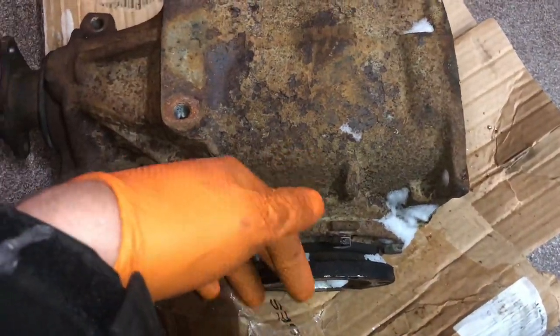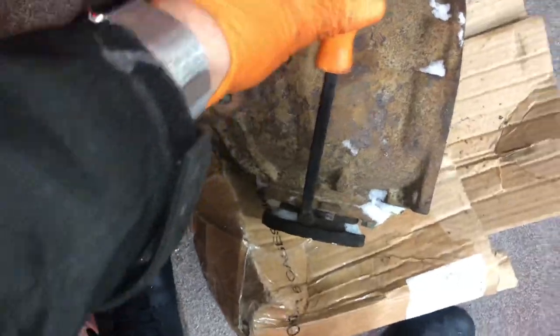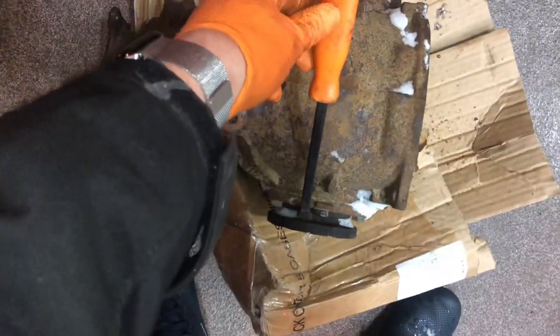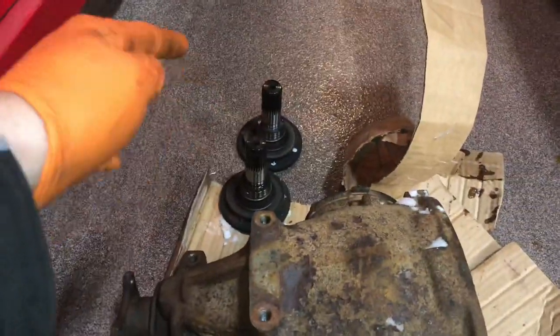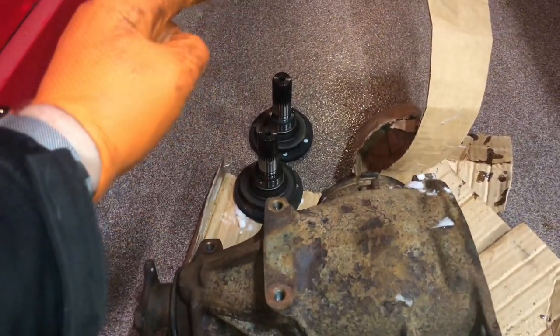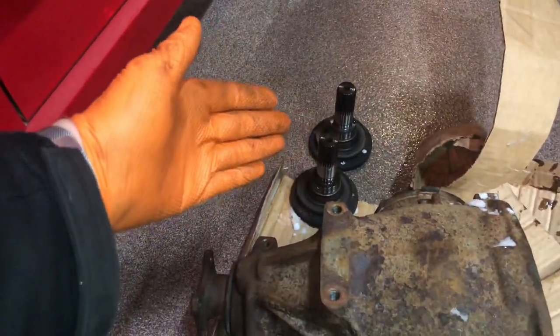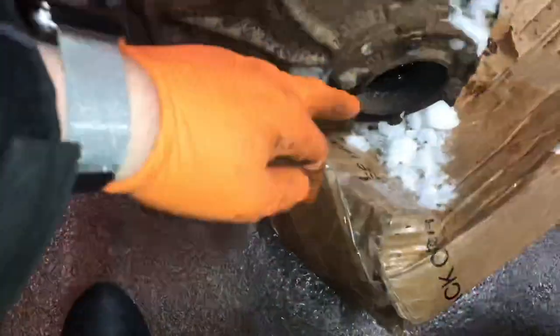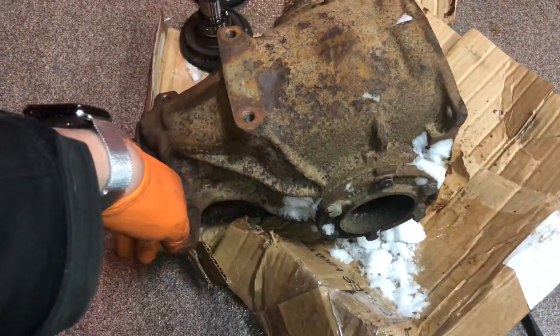So now I'm just going to knock both these flanges out. Grabbing my baby pry bar, I'm going to set it in just like that and thwap the end of this thing until it shoots right out. Easy as pie. Now, if you're working with an E30 differential — a limited slip or even a standard open diff — you'll have equal length stub shafts. If you have unequal length, that means you have a viscous coupling IX differential, just so you know. Next up, six 13mm bolts on each side — rip those out and then pry behind these bad boys.